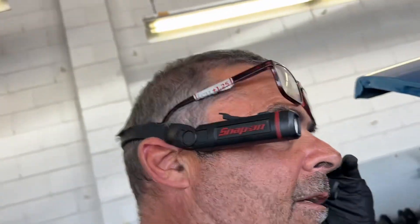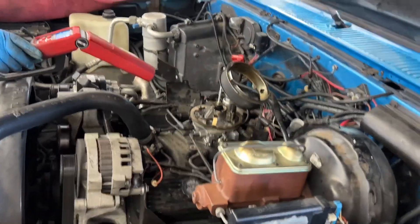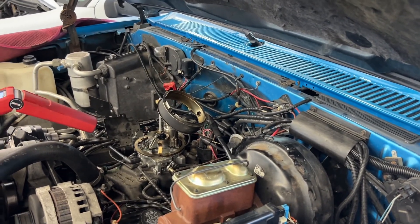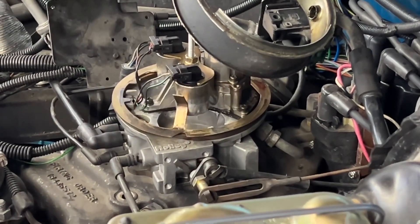It's a real old school setup — this is a Holley actual throttle body — but a lot of these new fuel injection systems have something like this. And that's a nice way to see what's going on with the injectors. You hook up that timing gun, you have that advance ability, and you can actually get a good spray pattern and physically see the spray pattern on that injector. I can see it clearly standing back here when you aim at it — it's really clean.